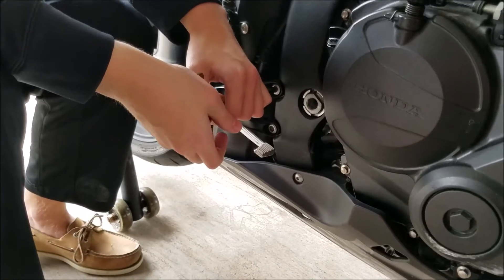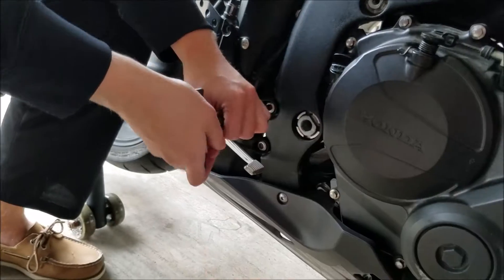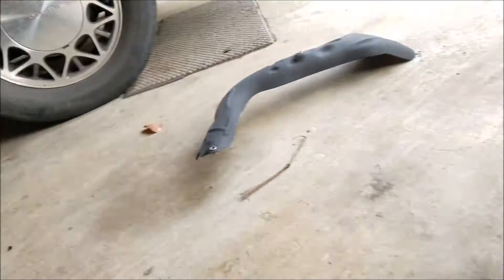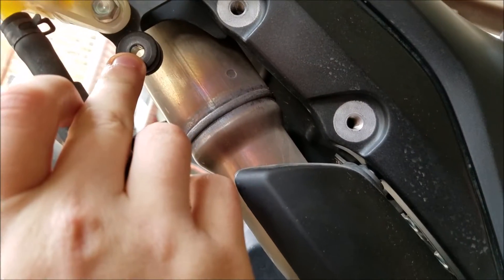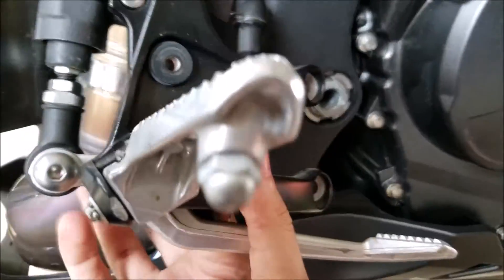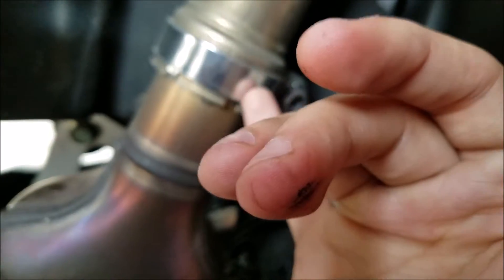What my intern here is doing is taking off the rear sets so he can get to the heat shield, take the heat shield off, and get down to where we need to connect the mid-pipe. We just got done taking that massive heat shield off. All we had to do is take out the screw from here and then there's a little rubber grommet in there — you just pop it off and the heat shield comes right off. We've got to undo this o-ring and then unscrew the other two bolts holding the exhaust up.